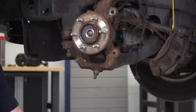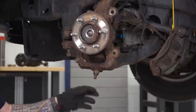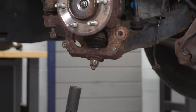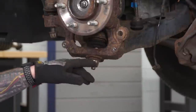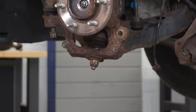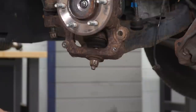With the upper control arm dislodged, we're going to do the exact same thing to the lower control arm to knuckle joint using a 15/16ths nut. If yours doesn't dislodge on its own, use a hammer the same way — making sure you're not damaging the actual ball joint.